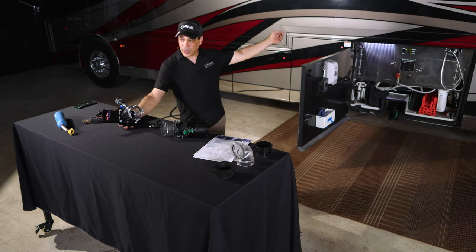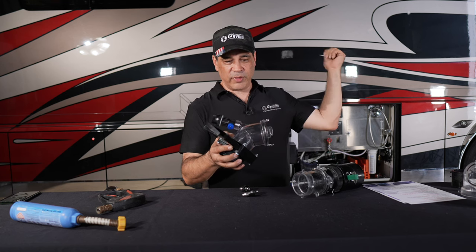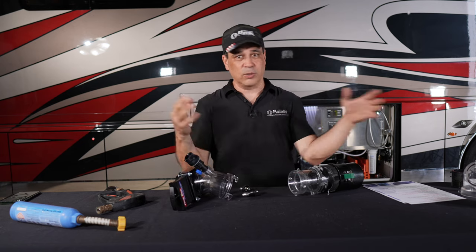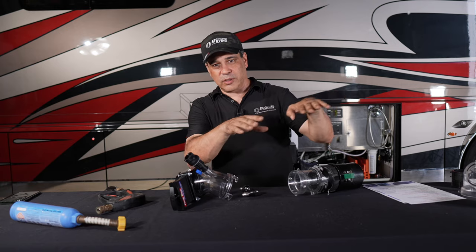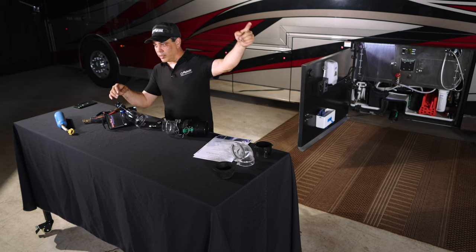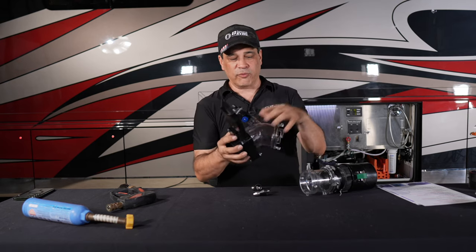On this coach I have where you can fill it from the top — that's great — but it goes in and it just comes right out. I do both in most cases. When I back flush, I'll have that run and then you can have the hose going up at the same time, because the whole point is we're trying to get as much agitation going on as possible. The other thing is it's going against the flow — when stuff dries in the bottom of your tank, it's usually going towards the exit and it creates almost like a riverbed flow. So even if you turn on your rinse from the top of the tank, it just follows the same flow. These give you a little better agitation because it's pushing up against the flow to help tear it up and get it freed up to come out.